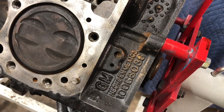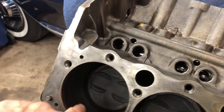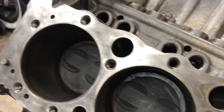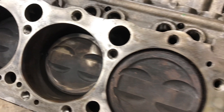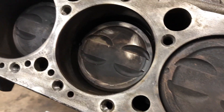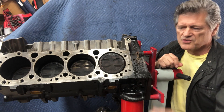This is one of the GM Goodwrench 350s that come out of Mexico — pretty solid little 350, four-bolt main. Nice thing about it is it doesn't have very many miles on it, maybe a little under 40,000. There's no ridge you can feel in any of these cylinders, no scoring or anything like that. So the block itself seems to have led a short and hopefully productive life. But these pistons have got some carbon on them — not a lot, not very bad. But as long as the engine's out, it makes more sense to do this rather than trying to pour something down the carburetor later.